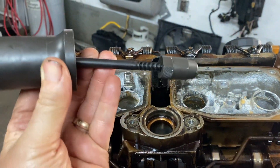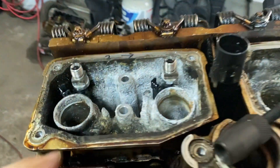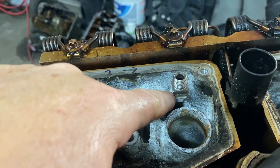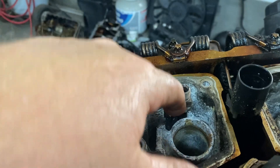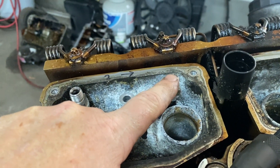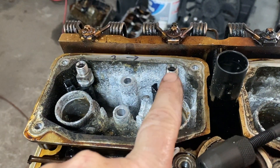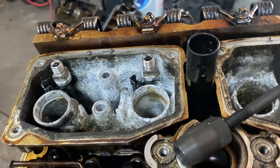Here is a tool that takes out the fuel injector — it's like a little slap hammer. These injectors are expensive and you can't just pry them out. You can break them, and these have to be programmed if you break them. When you take them out, they have to go back in their respective cylinder. This is the third cylinder — it has to be number three. Don't switch them around or the car is going to give you all kinds of codes. What you do is screw this on the top.